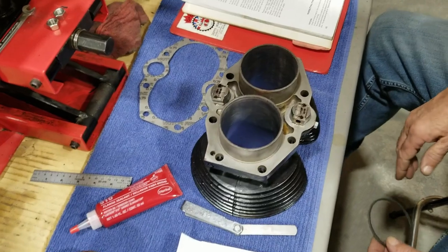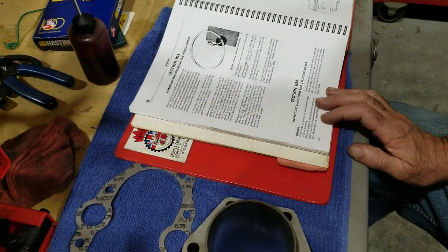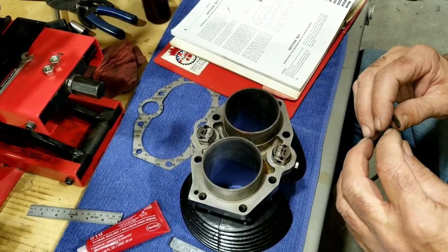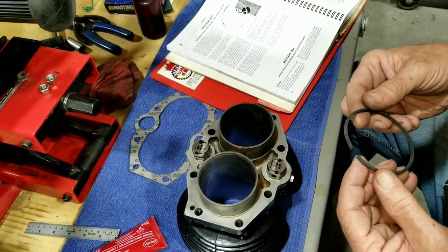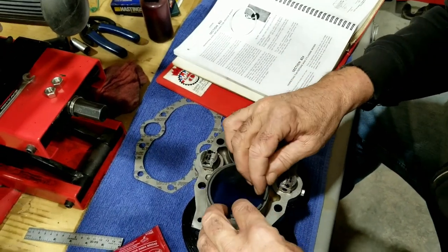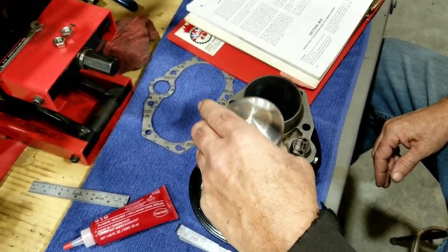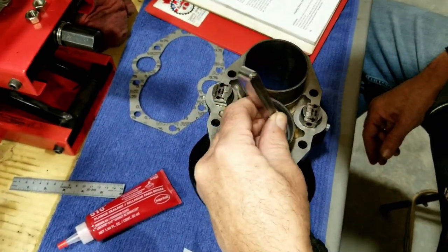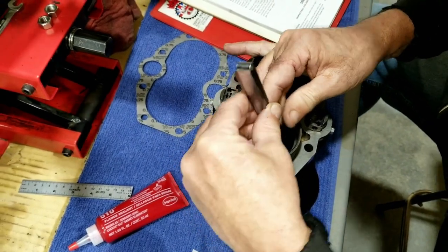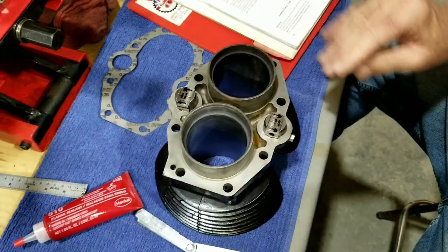Now we got oil rings. Scraper rings gaps. Yeah. They're supposed to be 10 to 14 also. What are you checking for? Well, I'm looking to see if there is a difference. Like they're the same on both sides. And of course it doesn't say up or down. Yeah, I can't even get it. I can only get it halfway. So the 10's not going. Too tight. Yeah, so that means we're going to file on these rings just to get them within specs of 10 to 14.